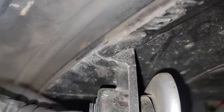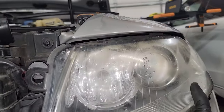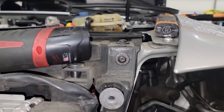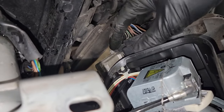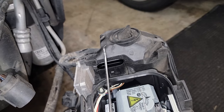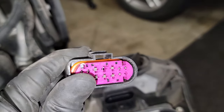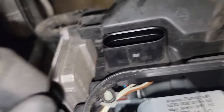Sometimes the little fastener comes off and starts spinning on you, so you have to hold it with the other hand and grab that. I'm filming with one hand in here. Now we're going to slide these out towards us — that'll give us access to the plug. The tab is broken off, but the light's still on there. If you run into that situation, use a pick, stick it in there, pry it back, and it'll pop free. Same thing on the other side.